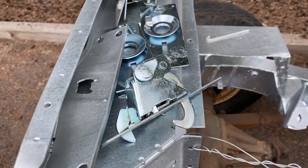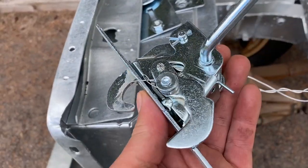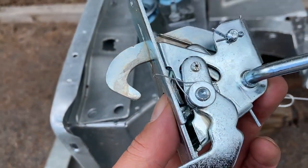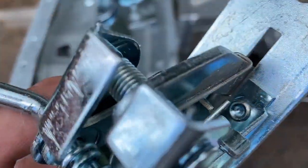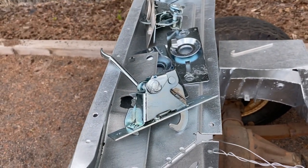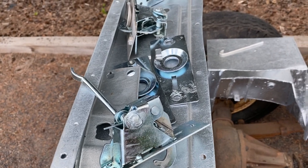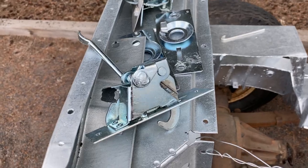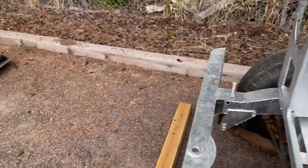Some stuff, like a mechanism like this, you couldn't galvanize because you'd never get it working again — it'd all be stuck together. So this is CAD-plated. It's a much thinner coating. There's not too many options for CAD. I didn't really want these pieces shiny, but I figured I could paint over them if I didn't like it. So I did have some stuff CAD-plated as well.